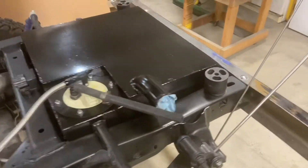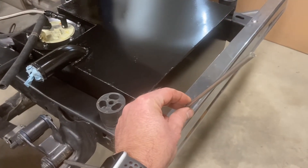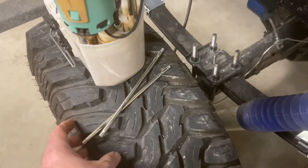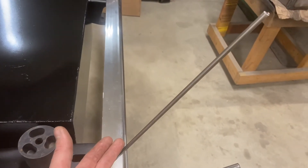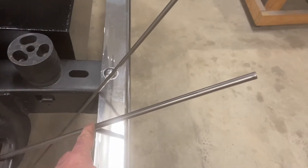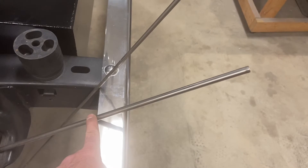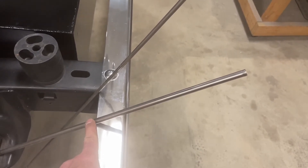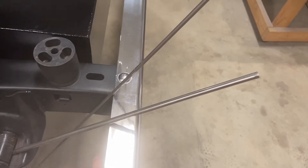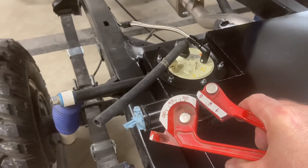One last thing — I've got a couple of rods here. We replaced the factory rods with quarter-inch stainless. The original rods are about 7.5 inches long, and to get the extra height for the fuel pump drop-in we're running about 10.5 inches on these rods. For the hard line, you can get this at a typical metal supply place — it's 304 stainless, 3/8" tubing with a 0.035" wall. You could get away with a little thinner wall but definitely don't go thicker as it's already pretty challenging to bend. I used a simple bend tool I bought at Summit Racing years ago.